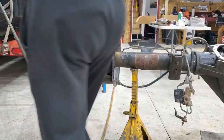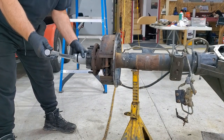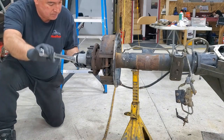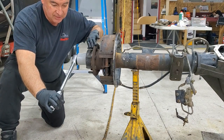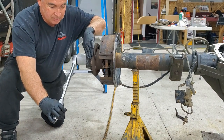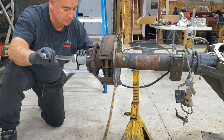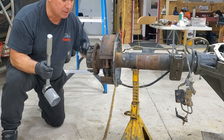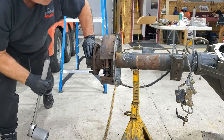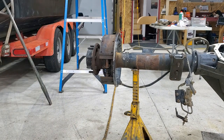I'm going to do my brakes — turn it over. How tight do you tighten a wheel bearing? This is a nylock, so it's a little confusing. What I do: come down and feel it rotating. At the same time, you feel it take up zero lash. Then you want to go about that much more. That puts a good preload on the bearing without being over tight — not loose. Too loose and you wipe out the seal and do it all over again.